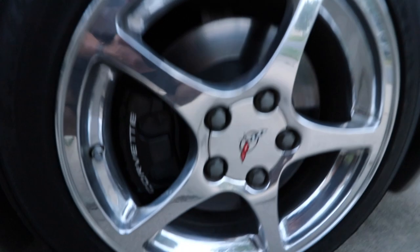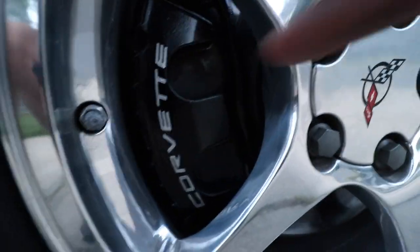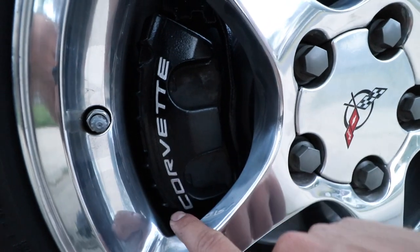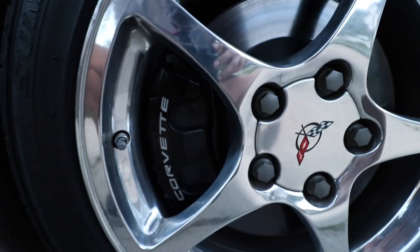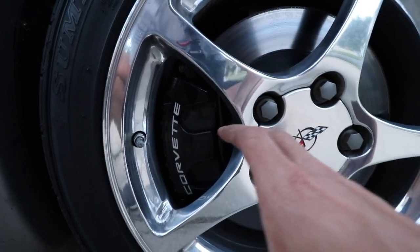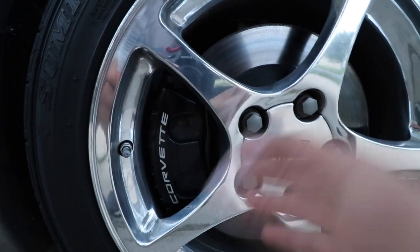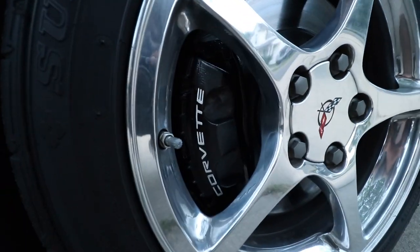I got the whole assembly back together. You can see just how good that really turned out, especially sanding off these letters right here — it just looks awesome. So again, this applies for any car: just unbolt the caliper, do it right, get the brake pads out of there, clean it really well, and for 15 to 20 bucks you get something that looks like that. It just really cleans up the car.